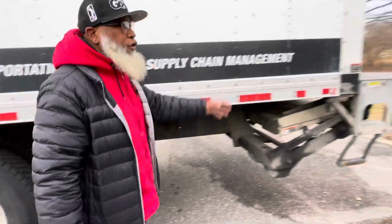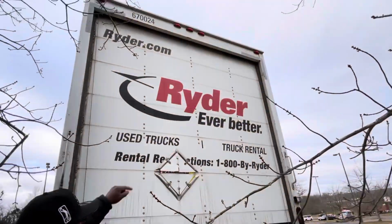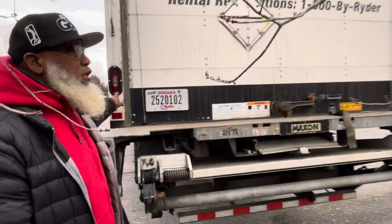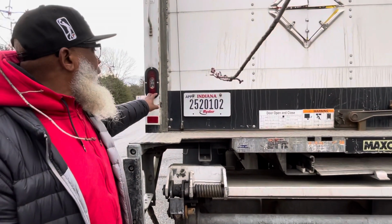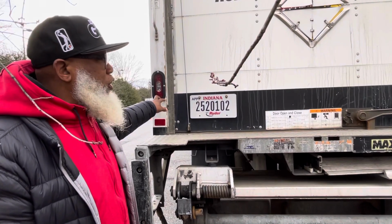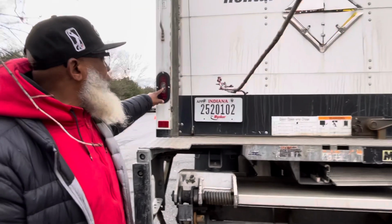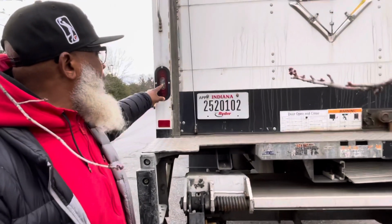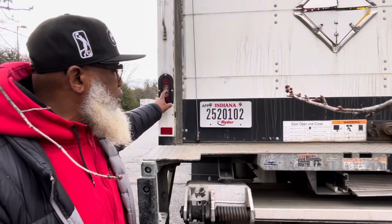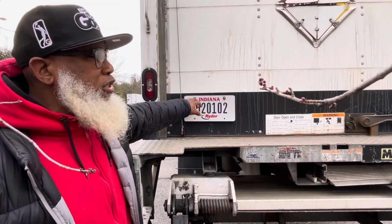To the rear of the truck. Now, I already mentioned my ID clearance lights. I said they were red in the rear, and the turn signal lights. So my brake lights are red in the rear, and they're not cracked, not broken, and secure, and no condensation. The reverse lights are white in color. They're not cracked, not broken, and secure, no condensation. The tag is securely mounted to the vehicle with no outdated stickers.